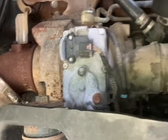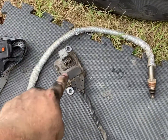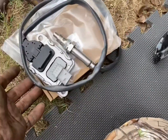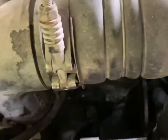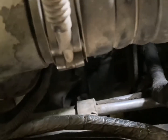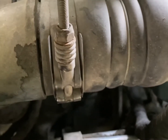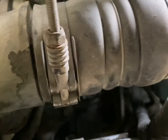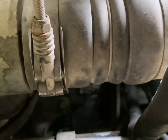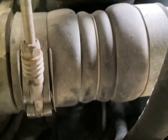Right there is where the old sensor is housed, and I'll show you the other end in a moment. I'm going to replace it with a brand new one — I'll put the part number in the description. This is the intake upstream NOx sensor and it's out of order. I already took it apart, cleaned it with Lucas carb cleaner, and cleared the code with my scan tool. It did go away, but then it came back, so it's time to replace it.